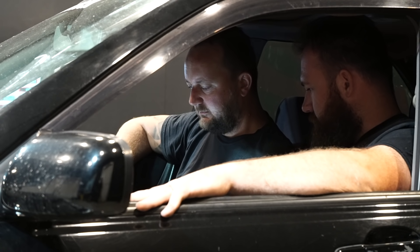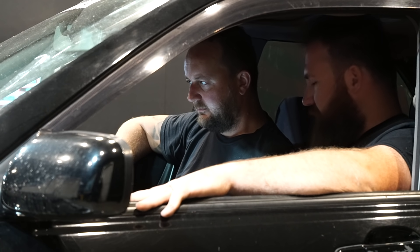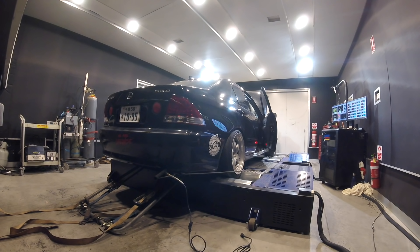The hint is: 50 kilowatts at load is where we do the injector size, idle is where we do the dead time, and then we massage them both. That's your at-home approach to just get it done. It sounds pretty happy — it's definitely a lot louder now with the extractors on it.